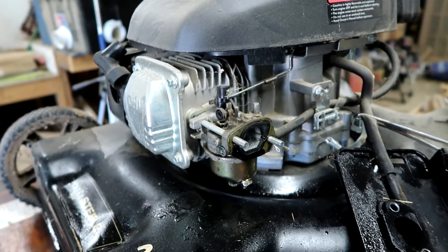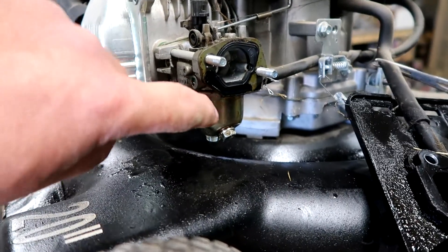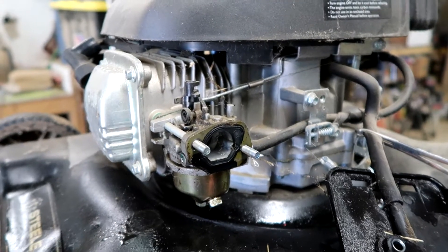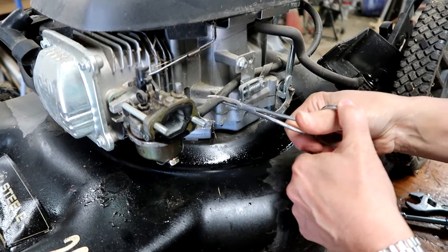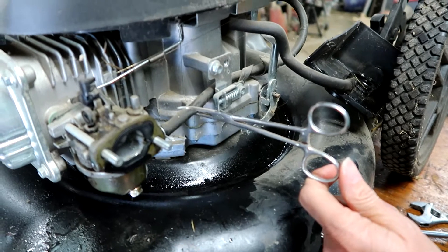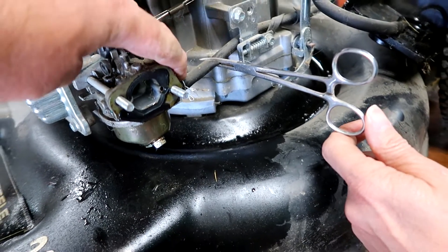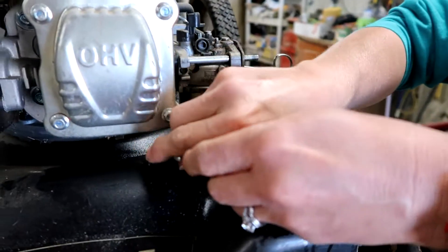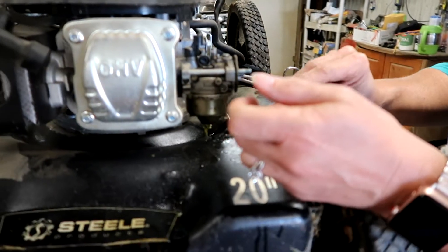So we're gonna find out where that leak is coming from. There's a bowl — we're gonna take this bowl off and just make sure there's no gunk inside, because again we don't know the history. Yours probably looks clean. These surgical pliers are nice to have — we're just gonna stop the fuel flow by clamping that. Otherwise you could just take the fuel line off and plug it. Vicki is going to loosen that bolt at the bottom that's holding the bowl on.